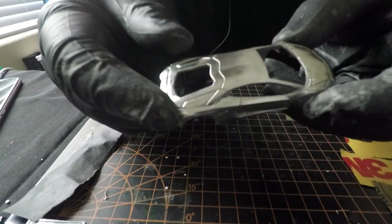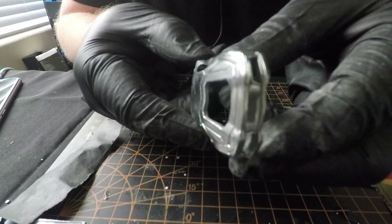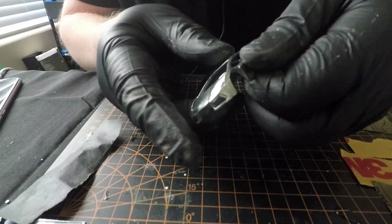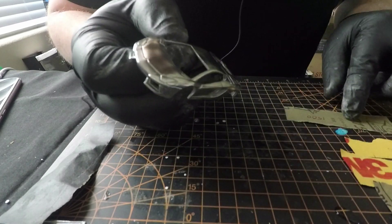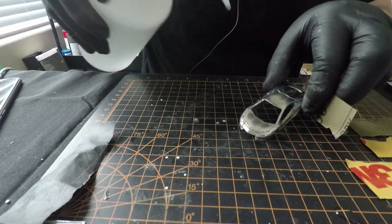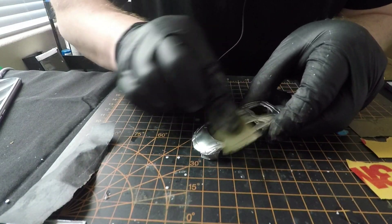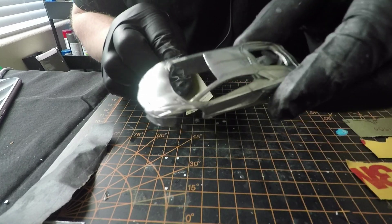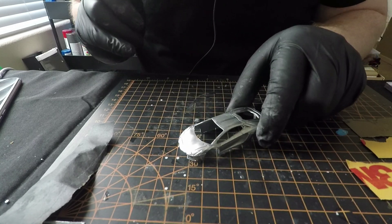Okay, here's what it looks like after you hit it with the Dremel tool. You're going to want to make sure you wear eye protection - you don't want to catch one of those little metal shards in your eye. So make sure to wear eye protection. Now that this thing is pretty cleaned up, we're going to want to move on to 600 grit. We'll just use this pad and this little squirt bottle, squirt a little bit of water down here, and then we are just going to continue the next stage of polishing and get all the high spots.